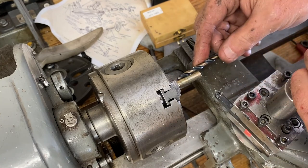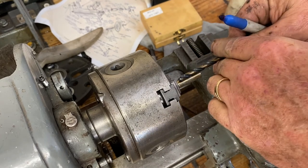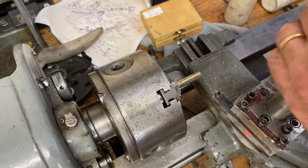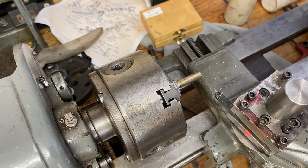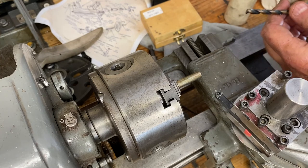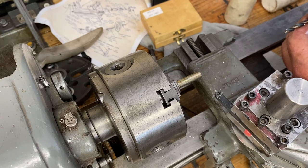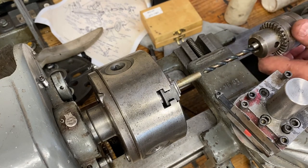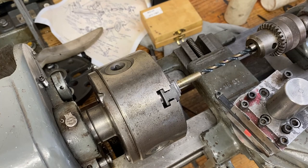Okay, we've got a little mark there. Put a mark on the drill bit — I'm going to go a little bit deeper than that. We'll turn it down. This piece is also a little closer to that 275 thousandths that is the ID of the actual hole where I want to stick it. So it's a little bit better. Will it work? I don't know. This is a new one on me — I haven't run into this before.